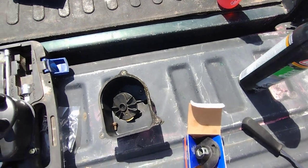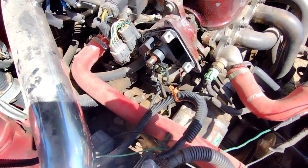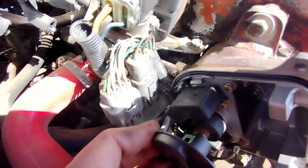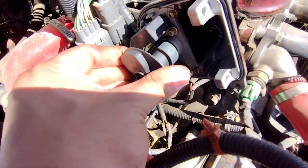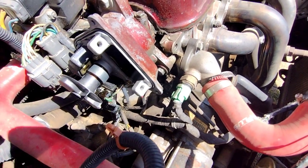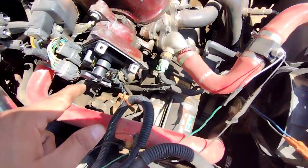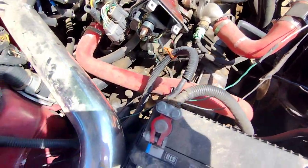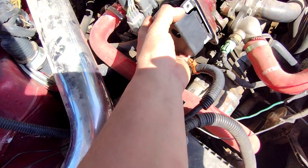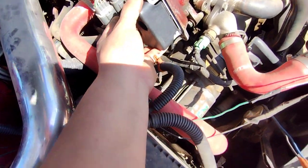It's going to be the correct one. Let's throw these on and see how that goes. Alright guys, the rotor can only go in one way — that hole lines up with that hole. There's a hole where the screw goes in to hold it. Oh whoops — I forgot there should be a cover right there. Let me put that cover on before I put the rotor on. My bad guys, I know. We'll put this cover on like so and it'll stay.